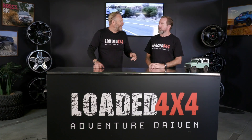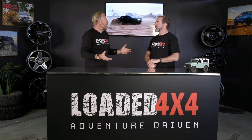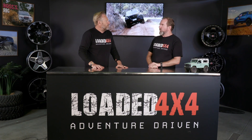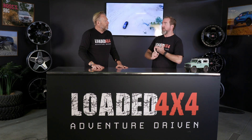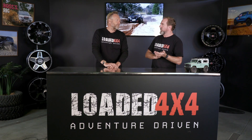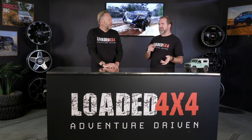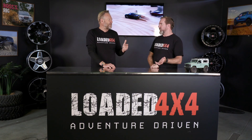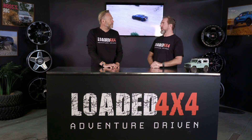Everything Georgia and Steen were saying about the Navara on-road — that was right. What's it like to overtake, how did it steer, how did it stop? It's good on all those points. It's only got a little 2.3-litre twin-turbo, but it gets up and goes. I actually think it's definitely got more grunt than the Triton — I reckon it's got more grunt than the D-Max and BT-50 too, from the seat of the pants. It's got that seven-speed gearbox which I think is shared with the Y62 Patrol — it's a Jatco unit. A bit slow and mushy to change, but it does its job and it's quite intuitive. And if it's handling the torque of that V8, you're not going to break it in the Navara. Beautiful to drive on the road — of all the utes, it's the one, I think.